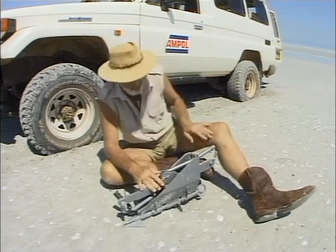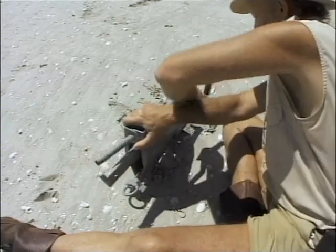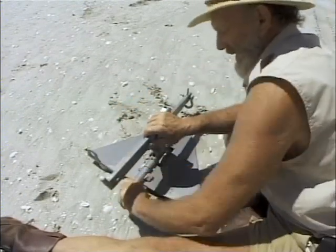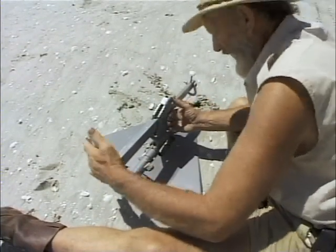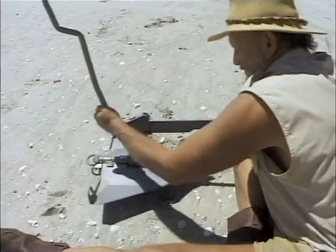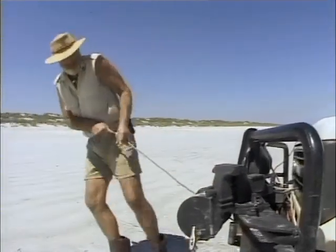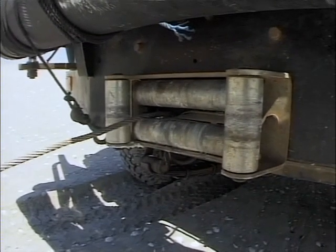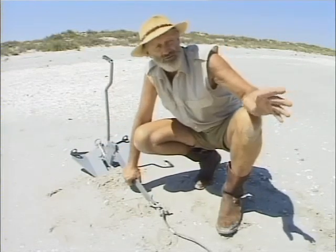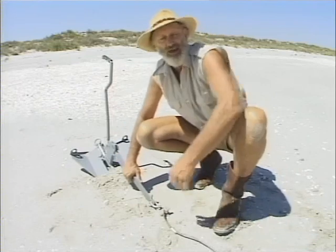Now I've got to move pretty fast because that tide's coming in. It's just a matter of pulling that pin out, taking this handle out here, folding down these wide sections and tightening them up. It takes a second or two. Sliding that pulling arm out, dropping that handle on there, put the pin back in, and it's ready for use. The portable tree's in place, so now I go back to the vehicle, start the vehicle up, start winding the winch in, and the portable tree will bite down into the sand and should pull me out very quickly.